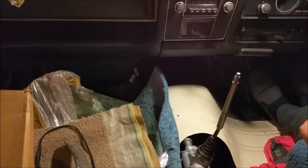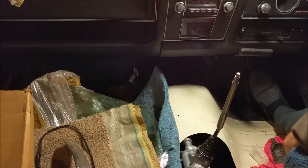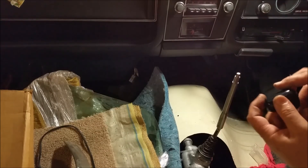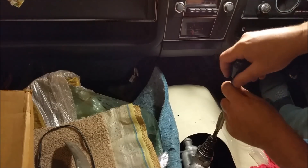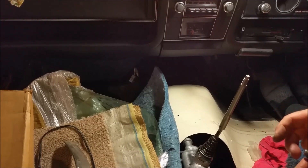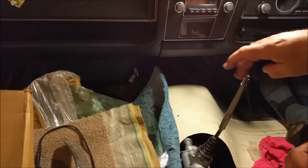And of course the box goes underneath. It needs a clean — that can all get mounted on. And of course there's a boot that goes there. But the pièce de résistance is this really lovely single rail knob. I was going to get a top loader one and try to modify it, but I'll never have been able to do it this well. The only thing that worries me is that it's made with just a bit of fuel hose shoehorned into the base of it, and I've got visions of that splitting. I cut that thread to 10×1.5 which is a metric thread, with the same size shoulder at the top, rounded off so we can stick it over. But it's really stiff and I just don't want to damage it. I'm petrified about it, actually. So I thought maybe putting a bit of rubber grease — this is castor oil based grease — might just let it turn a bit easier. Maybe a bit on the threads too.